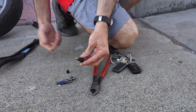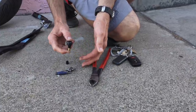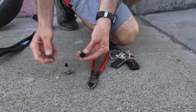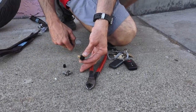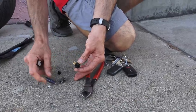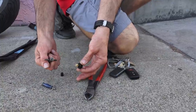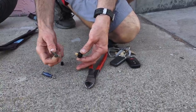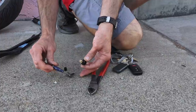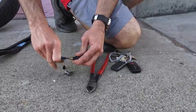A common leak point on scooter tires is sometimes the valve stem or the valve stem core will leak. This is referred to as a Schrader valve. If you're a bicycle person, you know there's Presta and Schrader — Schrader is what all the cars use. Mr. Schrader designed it back in 1896. You're going to need the tool that removes the core — a very common tool you can find at a bicycle shop, Walmart, or any automotive parts place. It has a little slot. You can get a tool like this as a reamer or just a basic little tool. Typically you want to remove the stem right out of it.